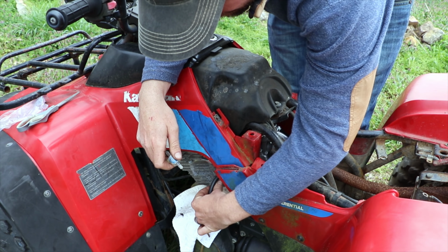Remember how to do those? Let me get it off. With these fuel filters, you want the fuel to come in, and then you have the filter parts that garbage can come in right here, and then it comes out that side. What are you asking me to do? Break it, so I can get these off. All right, hand me. Here. Go ahead and find the other one. This one? Mm-hmm. And pull those off there. Okay.